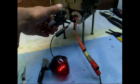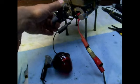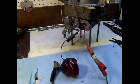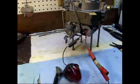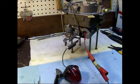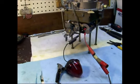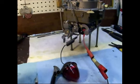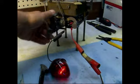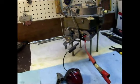That's the amount of opening of the throttle when your starter engages. And I believe there is a factory specification, but I guess there's some shims in there on the spring that you can play with. Book says put everything back in the way it was. I guess if you have a starting issue or problems, you could go in there and play around with those washers that are inside there and change them and just see what happens. I have to do a little more research to see if there's actually a spec for that. Initially, I haven't been able to find it, but I'll take another look. I just put everything back the way it was. It seemed to start good before, so we'll see. It is something that can be changed while the carburetor is still in the car, so not a big deal.